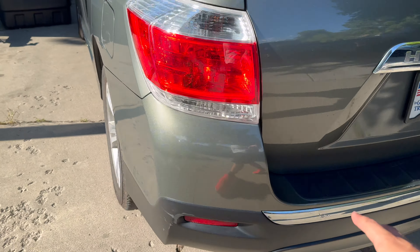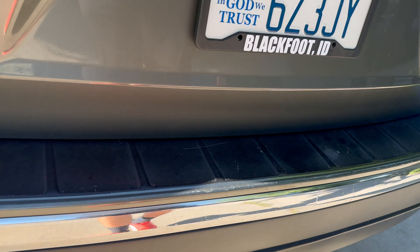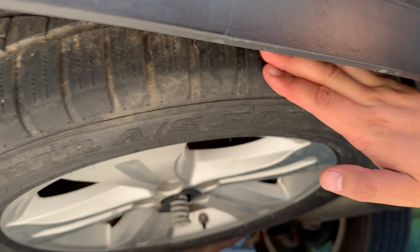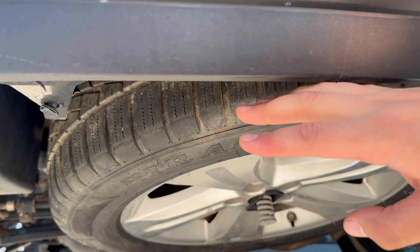Welcome back. If your SUV or van is making weird rear end noise, grinding and other sounds, check this first. Often times these sounds can be because of a loose spare tire. As you can see on here, this would make a lot of noise driving down the road.